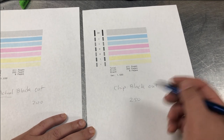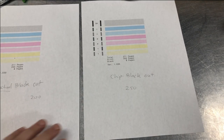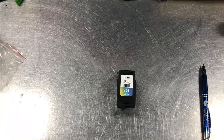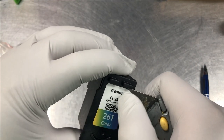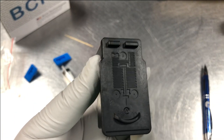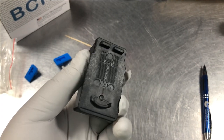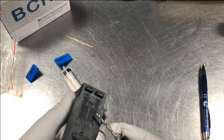I'm a little worried about the color because the actual ink level in the color is low, so I don't want to wait for it to actually run out — I'm going to refill it right now. Another advantage of refilling early: if it's still printing, the chamber is full of ink, so I probably won't need to prime it. Now I'm going to take out our EZ-30T. The color one has three colors; each region will have its own air hole just like the black. For the color, I normally drill right on the air hole.